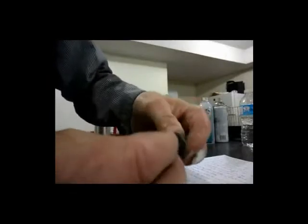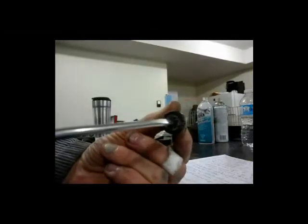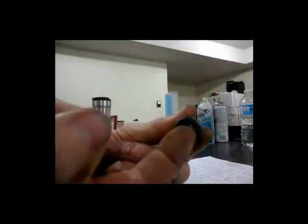The splash shield comes out as one piece — just move it off to the side. I wouldn't spend too much effort trying to save these little clips when they don't come out. Your best bet is to take a screwdriver, and if it's really brittle, just break the plastic piece and push it right through. This piece will then pop out. With the cap broken off, just put a screwdriver on the cap and give it a tap with a hammer to push that piece right through. Once it's out of the way, you can pull this out backwards.